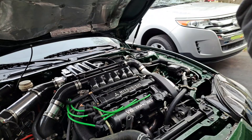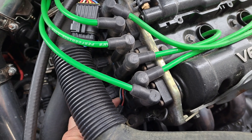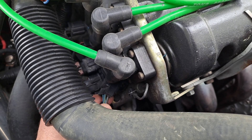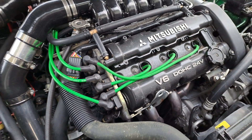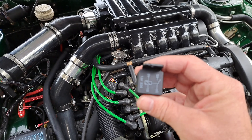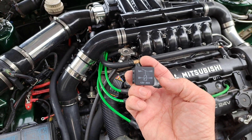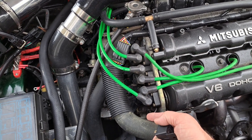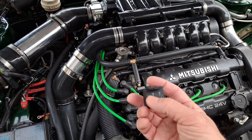I'm going to show you what we're getting ready to do. On the coil itself there is a red wire right here — that's what gives it the 12-volt feed. On the back side of the plug, on the harness side, it's a black and white wire. We're going to cut into this wire and use the signal off of it to trigger our relay. I've got a four-prong 30-amp relay. The 86 side is going to be on the black and white wire on the harness side, and 85 will go to ground.